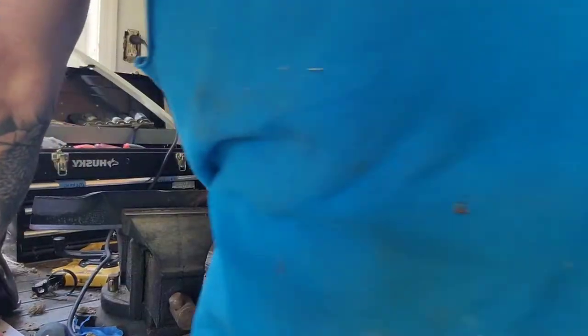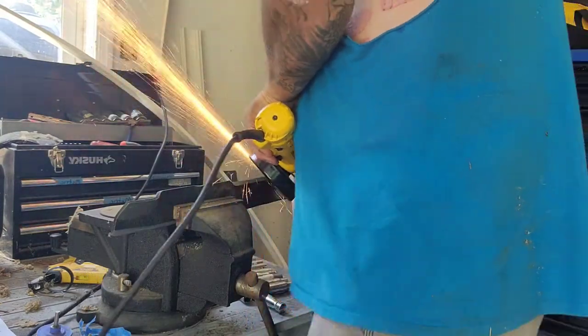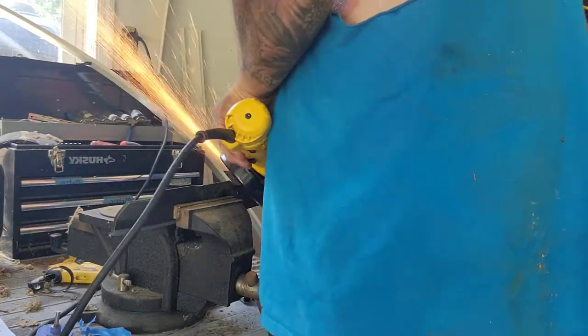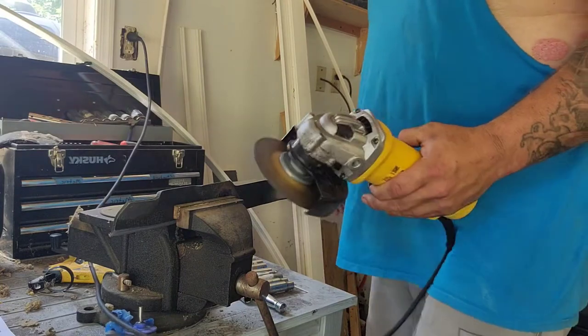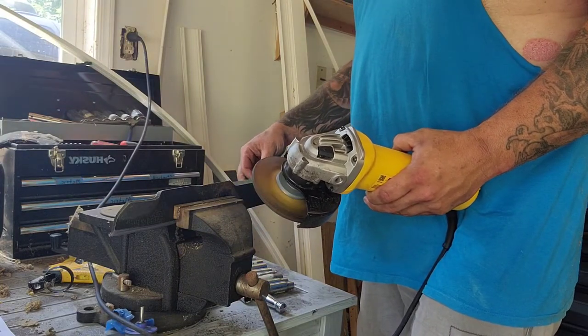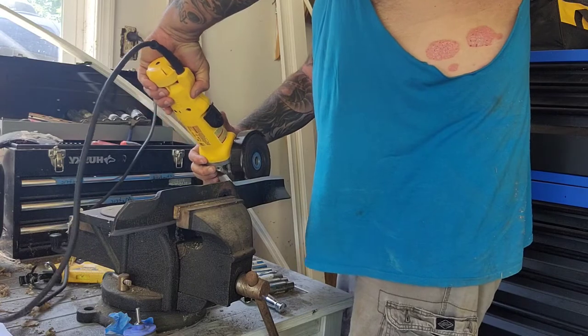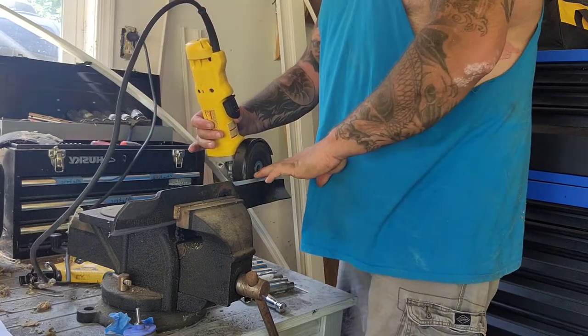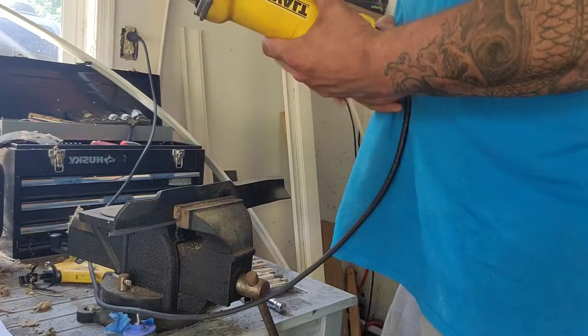It over, I'm gonna make the other side. When you sharpen these, it's going to start to build a burr on the back side. So what I do is I take the grinder and I'm going to go right here. That way it's only halfway on the wheel. It can't roll over that edge. I'll go back and forth on the back side, take that burr off.